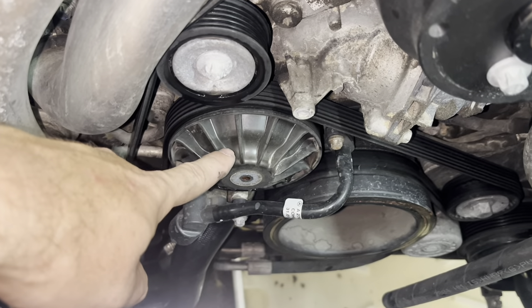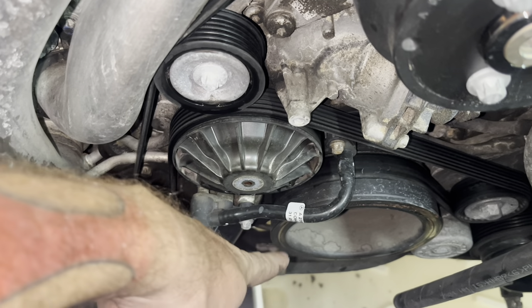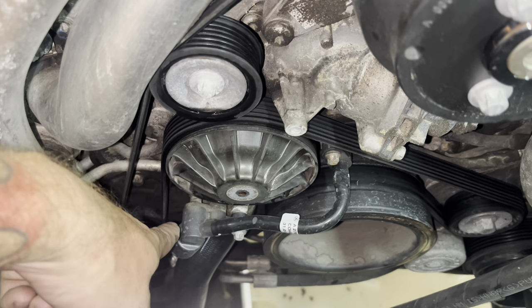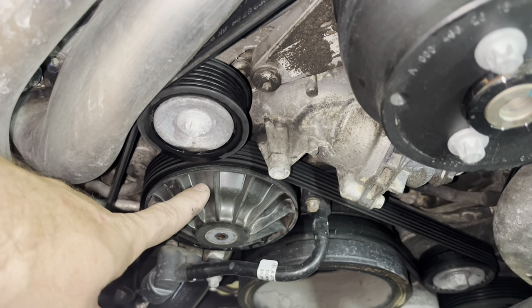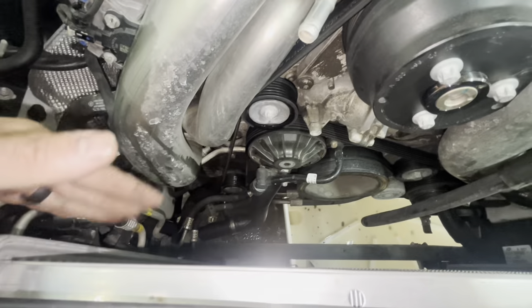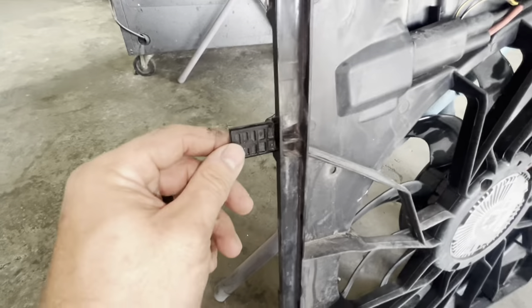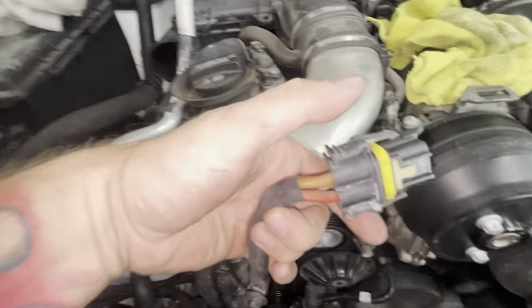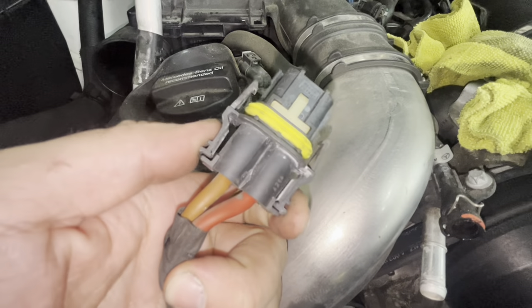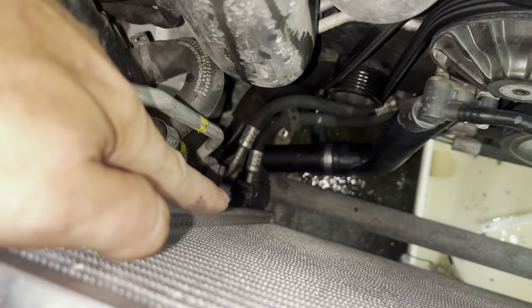You're going to find your water pump right behind here. We were looking up around this area in the cell phone footage. There's a little coolant line here — we've already covered that one on the channel in a previous video, showed the part numbers for this plastic line. Now we're going after this water pump. To get to this point, we've got our radiator fans out. They have just a couple clips on the sides and they slide right up — no bolts on this fan. It slips in with these tabs. Then you have your plug on the side of the fans that simply squeezes together to release the clips.